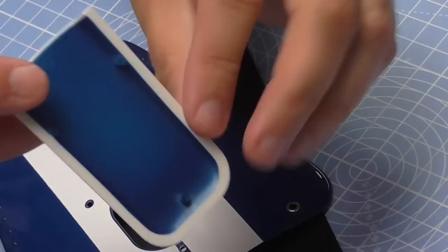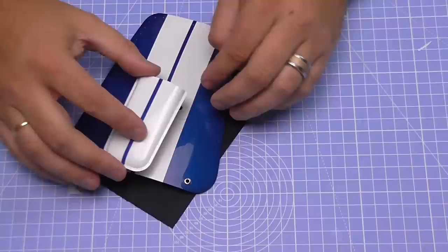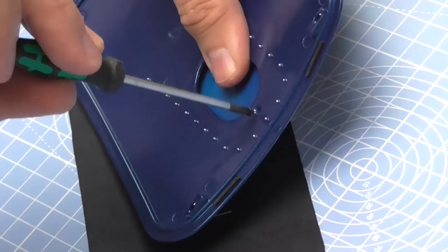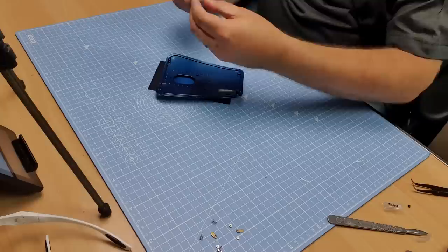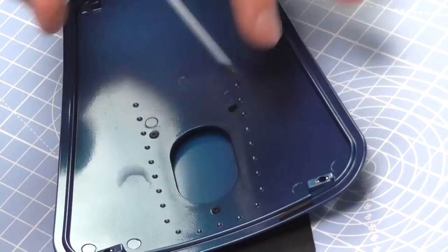Now we want to put the air intake over the top. The metal part is the base; the air intake is plastic with three lugs at the bottom going into three holes. It's going to be secured from the other side with OP02 screws — they're labeled up here. Line up the holes and get the first one in. I've put them in loose at first to make sure they're all lined up correctly. Here's the second and third. Once they're in, tighten them up — don't over-tighten as they're going into plastic; hand tight is enough. That's the air intake on the bonnet.